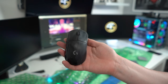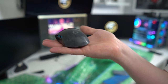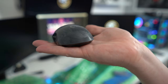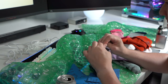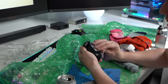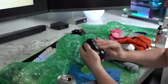You want to start with a 2500 grit sheet and start sanding in a particular area, slowly moving around the mouse, paying particular attention to the edges around the left and right clicks. These areas are stubborn as the edges are very difficult to sand. When sanding, try to avoid causing any stress to the switches. You can use the spare covers for the side buttons included with this mouse. The polish will turn the side buttons glossy later on. There's no need to sand them.